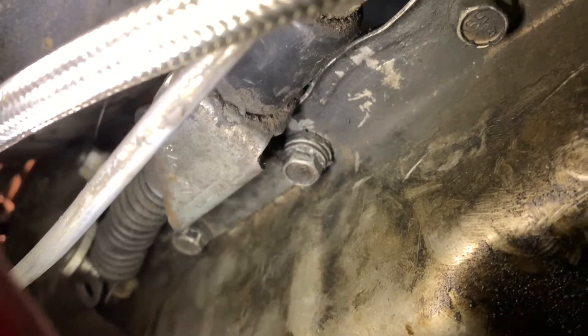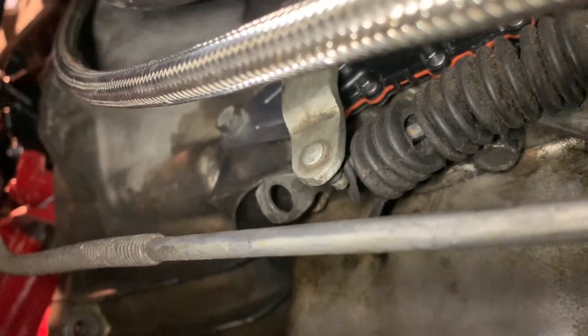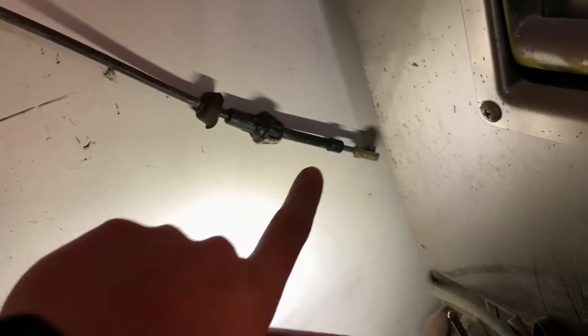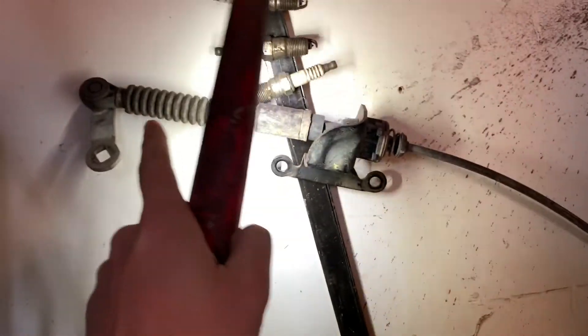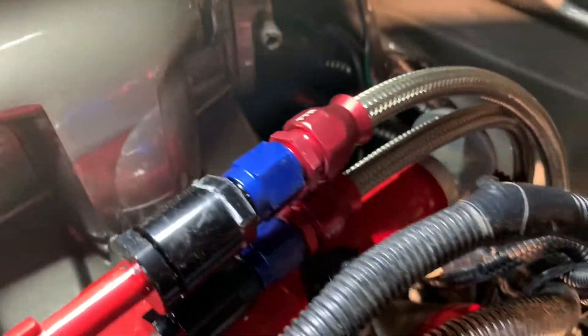While I'm down here I'll show what I did for the transmission cable. I mounted it to the stock bracket on the transmission pan. The truck cable is longer and mounts higher on the transmission, so I had to remove that bracket completely. I've hooked it up and gotten it into all the gears — everything works fine. I just need a keeper to actually secure it on the shifter linkage. I could use a fourth-gen piece but it doesn't fit the shifter without modification, so I'll find a keeper instead.